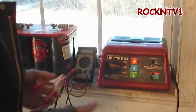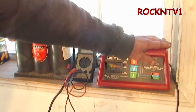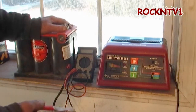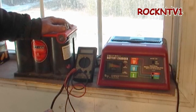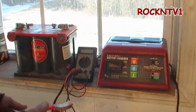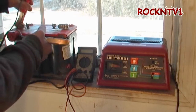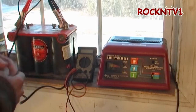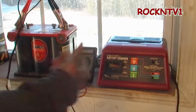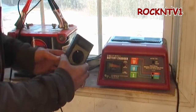However, if you have a battery that lives outside — a 12-volt battery like this one, which is a gel battery — this charger does have an AGM switch on it, as well as a regular lead-acid setting. Any 12-volt battery is going to sit somewhere between 12.3 and 12.8 volts, and that will show you how good it is. If it goes down below 11 or 10 volts when you put it on load, something is wrong with the battery. If it's being charged by your vehicle, it will be around 13.8 volts. However, if you've got an old vehicle and your headlights are going up and down, that shows your battery is taking a heavy load and your alternator isn't doing well enough.